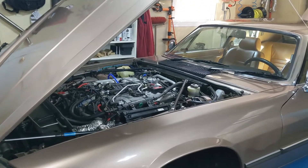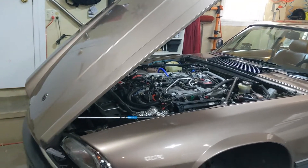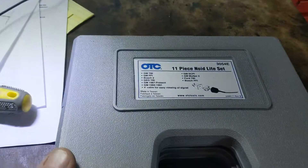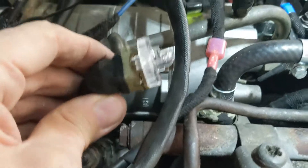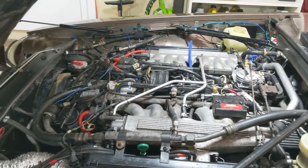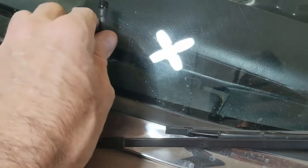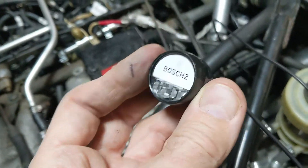The theory — which seems to be proven correct — is that a little fuel is injected into the cylinders at cold start by pressing the accelerator. I've got this noid light kit. The most accessible injector is at the end. These cables are also stiff so you have to be careful. There it is plugged in. That should flash — it won't fire the cylinder because there'd be no fuel, but that's okay. This is a simple fiber optic cable that captures the light and delivers it to where you want to see it. I'll run it through to the windscreen. It says 'Bosch 2' on it.